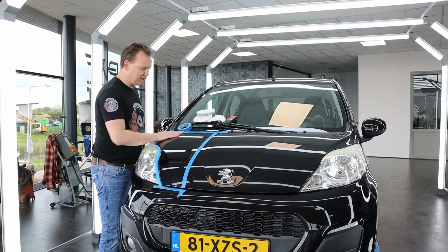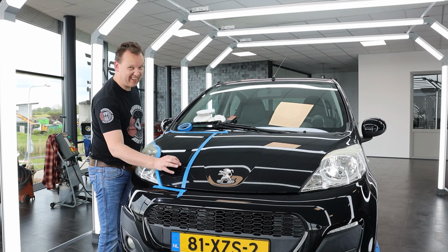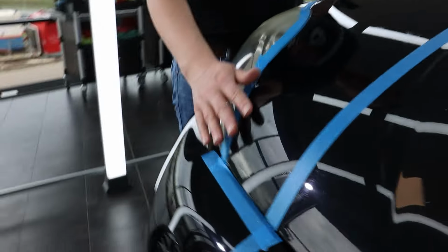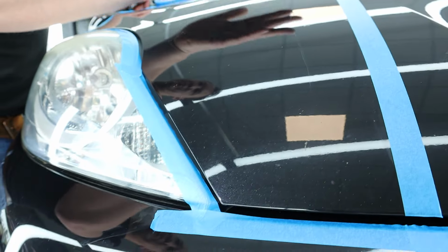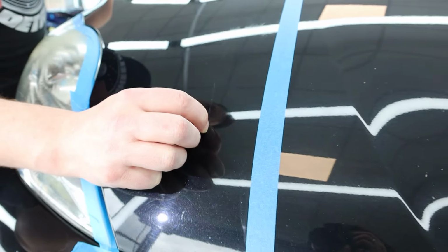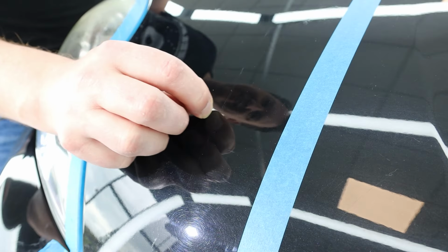After measuring the paint, I always like to feel with my fingers or with my nails. Oh, that's a terrible sound over the paint. I do see a lot of marring that comes from the clay mat. Just after washing, I completely clayed the whole car, which caused this grayish kind of shimmer. There you see some burned in bird poop rests here and here. And here we see a deeper scratch, which I actually can feel with the edge of my nail. It sounds terrible.